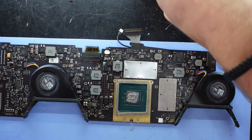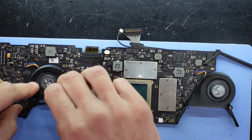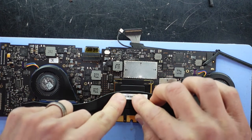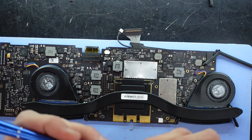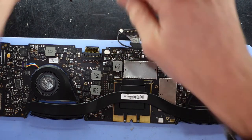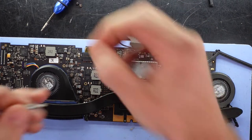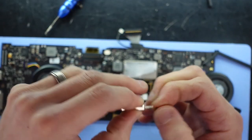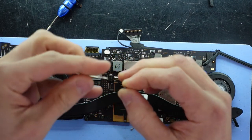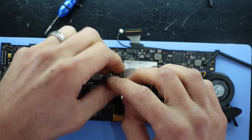Okay, put the cap back on. Now I need to take these bits off here. And turns out I didn't unscrew that one there, but that is fine. Line it up. Push. And let's put those screws back in. Ooh, nearly lost him. I'm going to switch to a different screwdriver. I'm almost certain they are T5s. But that is a worn T5. That T5's not going in. We are T4. Now, we'll just do them by hand to begin with.